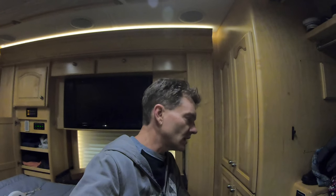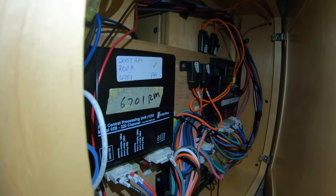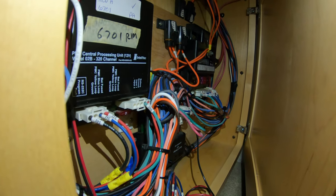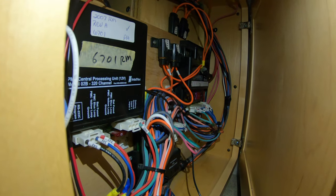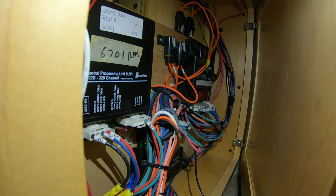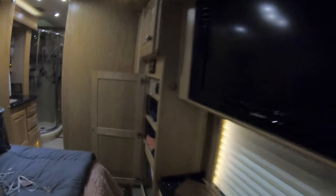Starting with the rear passenger side slide room — where it got its power is here in this closet. Got the Intellitech output modules here, tagged into the ground there, and hooked up to that spare output that the factory would have used for a desk option, but they didn't have that in this particular coach. So I used that, put a 3-amp fuse in there, wired into it, made my way across under the combo washer/dryer, popped out across the top of that room, and made my way down in behind the safe.